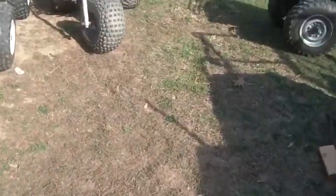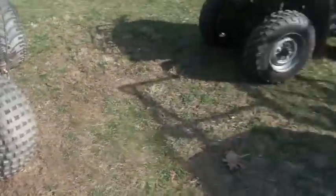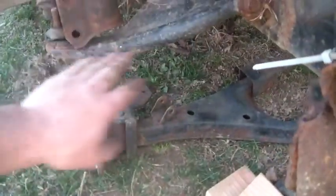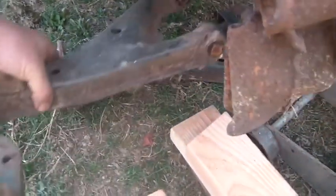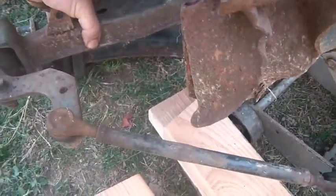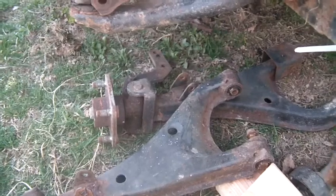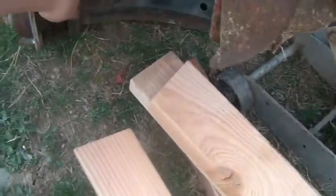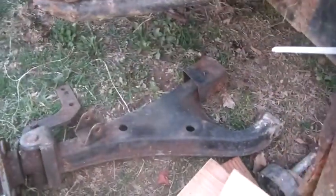I've been doing a little looking and figuring at my golf cart horde, trying to determine what I'm going to do. I think I've got the front end figured out — I'm going to put kind of a dropped section coming right out of here, send that a little further underneath so the tires sit where they should. I'll use the original shocks and the rack and pinion. I might have to move this forward a little bit. Unfortunately, I'm still scratching my head on the engine.